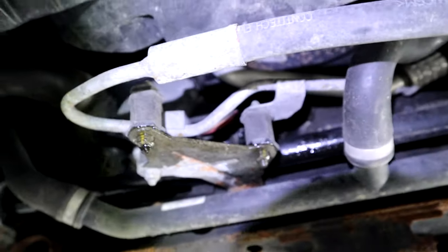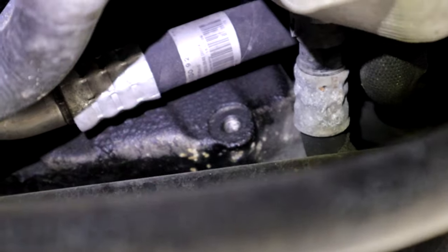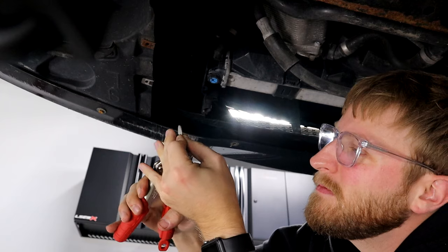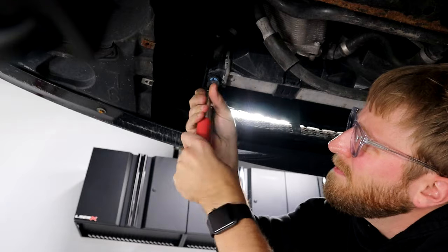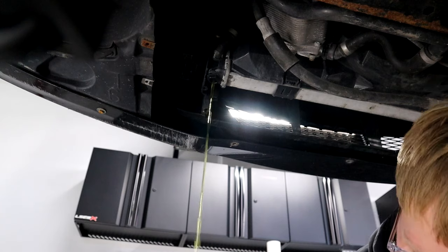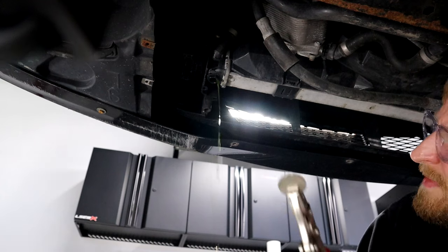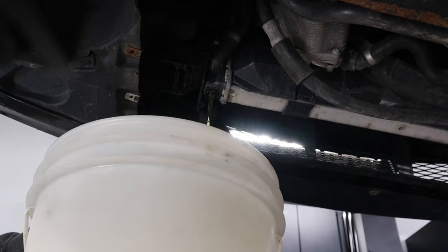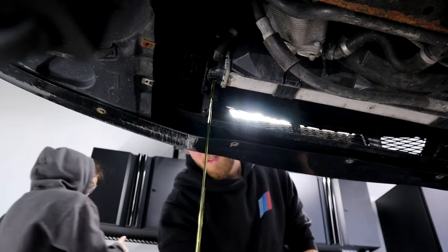This is a little peek at some of the oil underneath the car, but it's really bad on the engine itself. This is the oil pan — it looks black, it's so full of oil. And while we're down here, I'm going to go ahead and drain all the coolant. You don't want to use a screwdriver for this — grab a quarter and a vice grips, and this will loosen up the drain plug on your radiator. I'm draining all the coolant because to remove the oil filter housing you've got to deal with coolant. I doubt this has ever been changed, and immediately seeing the color of this coolant has me a little bit worried. I'm glad we're changing this.